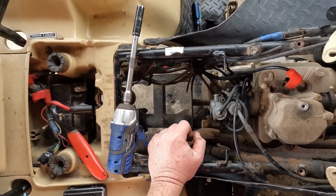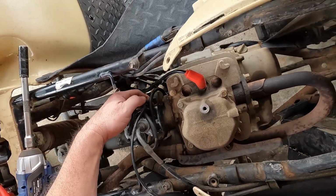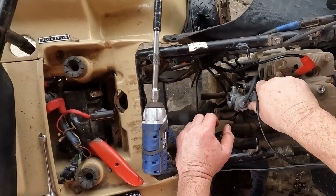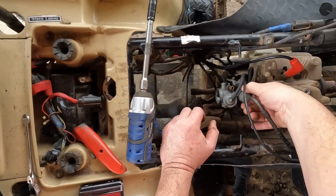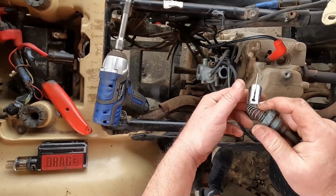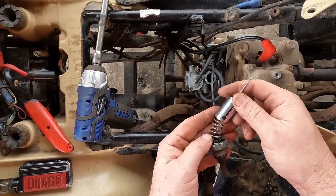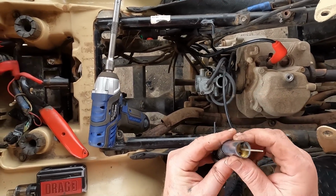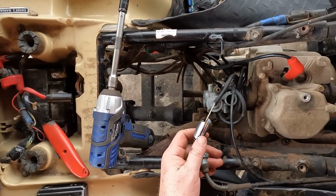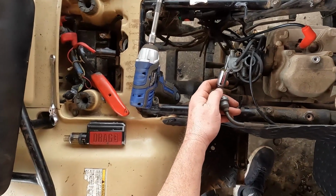Let me get this carburetor off. 2 10mm bolts. It just mounts right here. It's real easy to get off. Taking the throttle lever plunger out. Everything looks good. This will only go in one way, by the way. If you ever install one and when you crank it up, it just revs real high, you probably reinstalled this the wrong way. Done it.